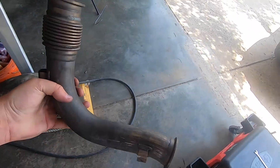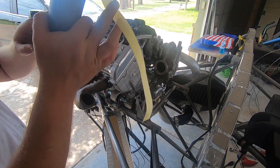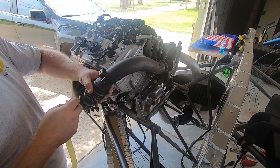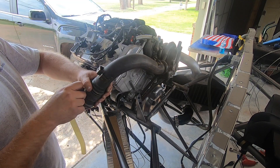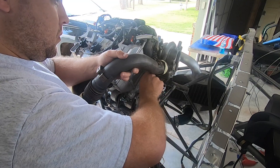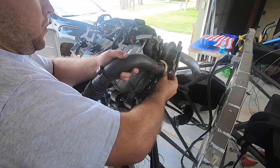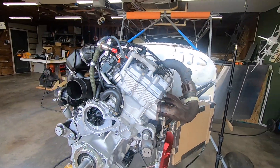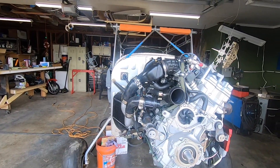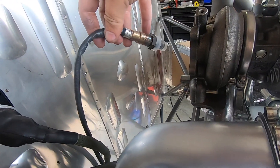After that I fit up the next piece of the stock exhaust system, although I don't yet have the V-band clamps for this, so the tape will just have to hold things for now. I seriously considered not using the stock manifold and finding a custom unit that would save me some weight, but in the end I think it's hard to beat the amount of engineering and development thought that Yamaha put into these parts, so I'll take the weight penalty in exchange for some peace of mind that I won't be battling cracking issues down the road. It all tucks in nice and looks like I shouldn't have any cowl fitment issues.